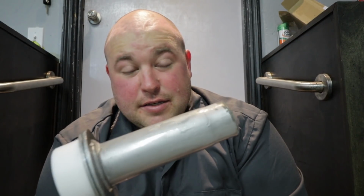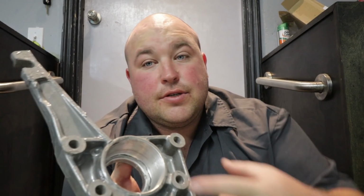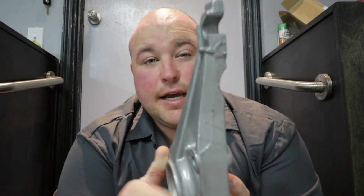By throwing this entire assembly back in the oven, I was able to get the bushing itself off. And what that means is that I now get to go back and continue to clearance all of this out. I'm gonna be using the big sanding drums that I was. I'm gonna keep pulling material until I can get this bushing to slide all the way in and turn by hand. And you'll notice that's as far in as I can get it, and you can still see a gap inside here where it's not fully butted up. And if I push it any further, it gets stuck.